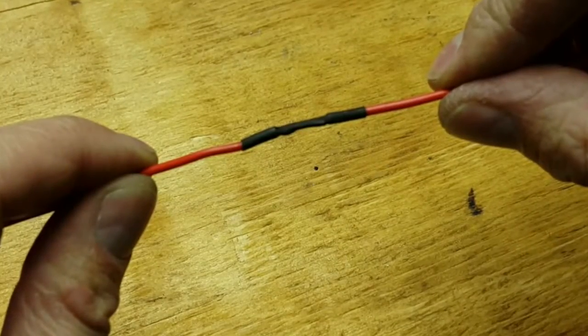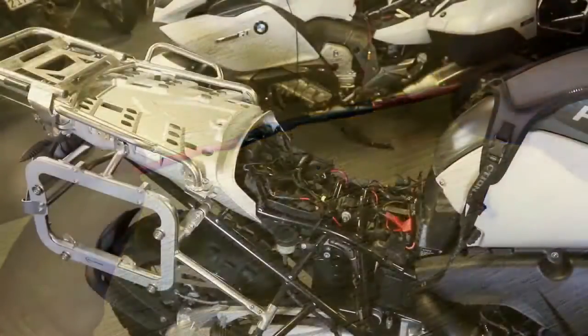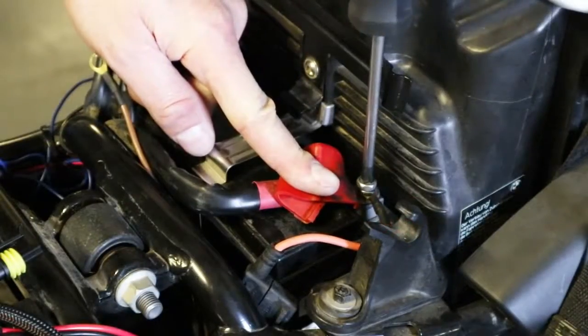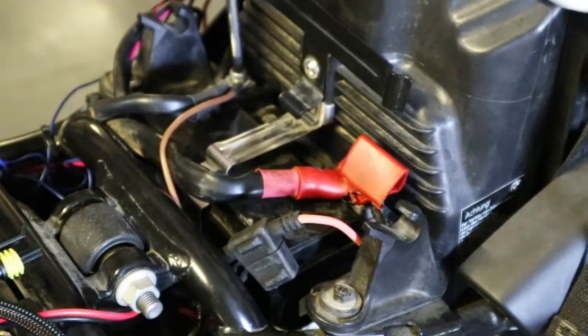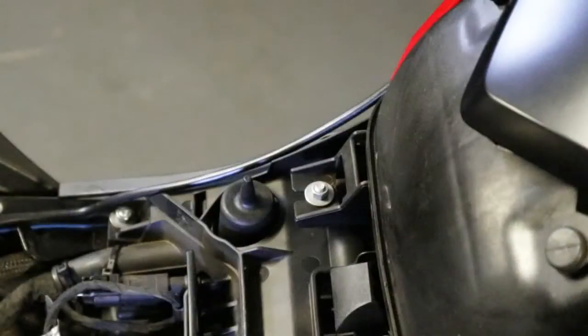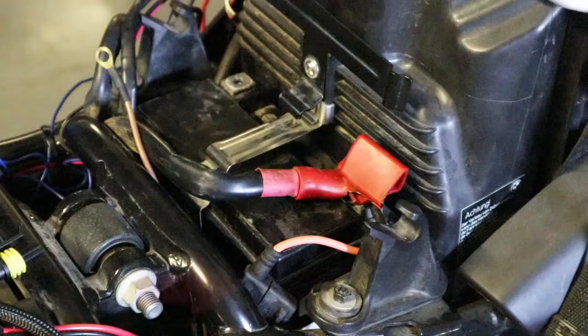For best reliability, connect the stub connectors to the wiring of your accessories by soldering the wires, and insulate the soldered joins using nylon heat shrink tubing. Route both the EZ-CAN power supply cables forward along the motorcycle's rear subframe to the battery. Connect the orange power supply cable to the battery positive terminal. Connect the brown EZ-CAN power supply cable to the battery negative terminal. Make sure that both battery terminals are securely tightened. It's very important to make sure that your installation will be 100% reliable. Wherever possible, make sure that the EZ-CAN wiring runs alongside existing electrical wiring. Use the cable ties to fasten all wiring. Make sure that you mount the EZ-CAN fuse holder in a location that is easy to reach — this fuse holder will be secured near the battery positive terminal.